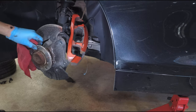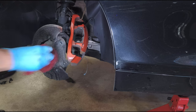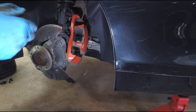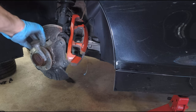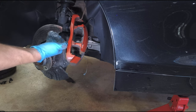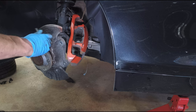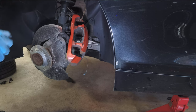The first thing I want to do is prep the spindle. It's corroded — I'm up in the northeast and everything just rusts. I'm going to rag and wipe it down. One thing that can help with the rotor coming off is putting some never-seize around the area where it mounts — that will help it come off easier next time and stop it from rusting to the spindle. If you can't get yours off, I'll have a link in the description to a video where I use a bolt and two nuts to drive the rotor forward off the spindle. That will apply more force than you'd ever get with a hammer.